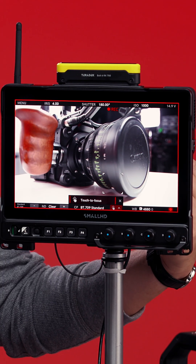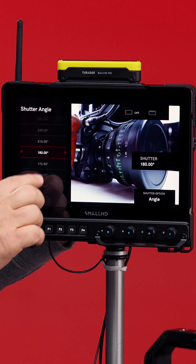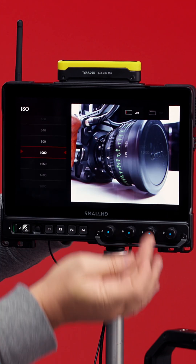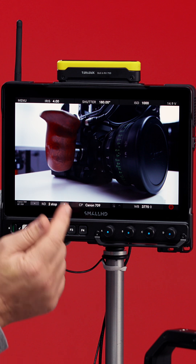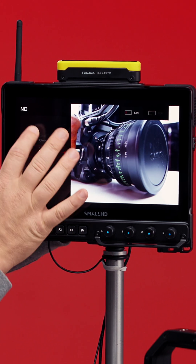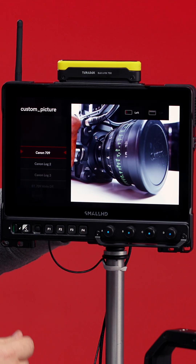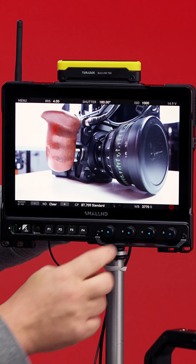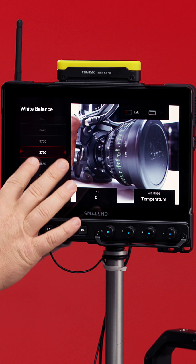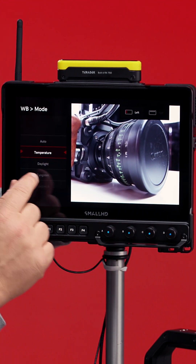You can control shutter, and you'll see a nice sliding shutter angle setting on the left. ISO you can change here. Turn on your ND — two stops, four stops, or if you select it in the middle you can slide all the way to six stops. We also have color profiles, and then white balance. You can adjust the temperature by sliding up and down, or if you tap it again you can access the different white balance controls.